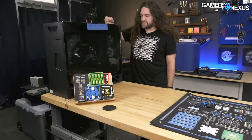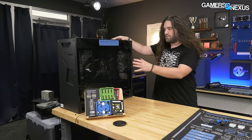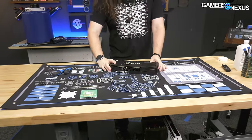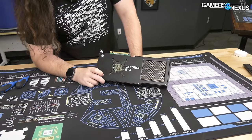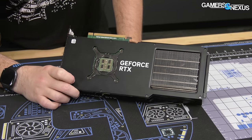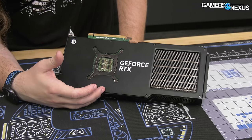This massive unit next to me will end up with the Dell 4090 and a water block on it, which is why we want a reference PCB. Reference does not mean Founder's Edition — we're specifically looking for component clearances like chokes and the VRM to make sure the water block will fit. OEMs commonly use reference designs.